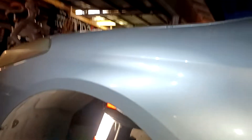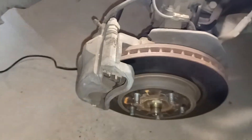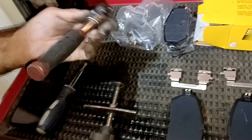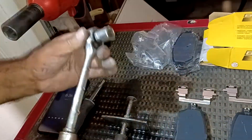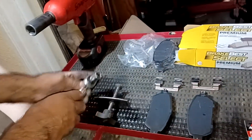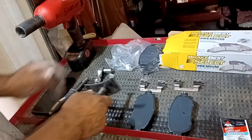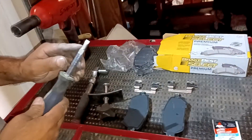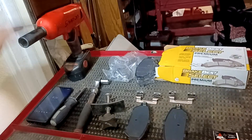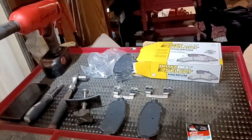All the tools you're going to need: this is a 14 millimeter for this, your brake pads right here. 14 millimeter, an extension, 3/8 — very good to use for the brake caliper, brake caliper tool, flathead, 22 socket — I used that to take off the tire, and I already took it off. This is what you'll need.